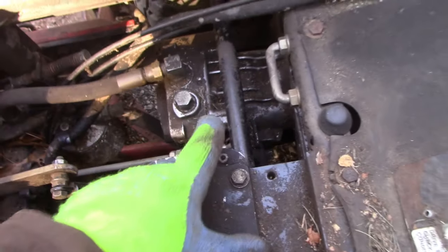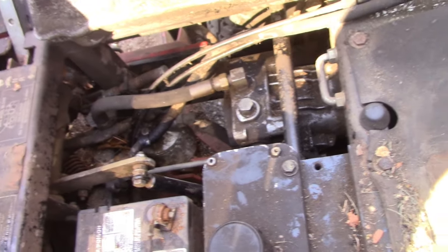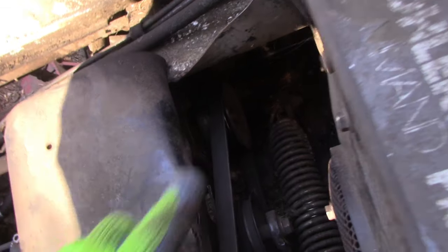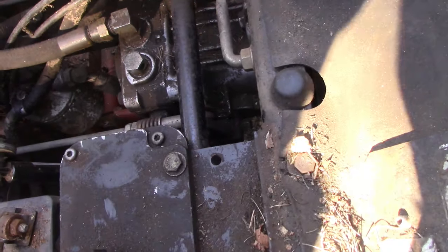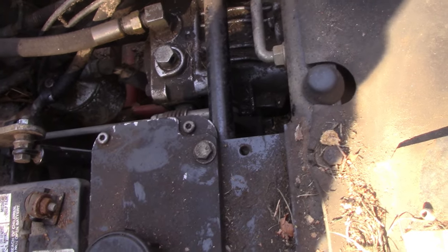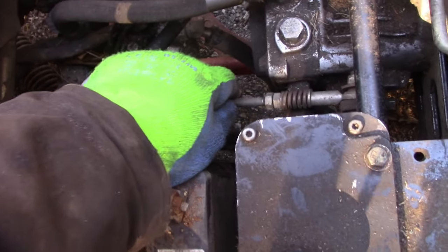These pumps are pretty much bulletproof — unless it's leaking oil, they're not going to have steering issues. If you do have an oil leak, it'll be on your input shaft spinning shaft and you'll see oil everywhere. It rarely leaks out of the side input shaft since that only rotates about 30 degrees. And it's generally not the adjusters either — if you grab them and there's no play, that's not the issue.